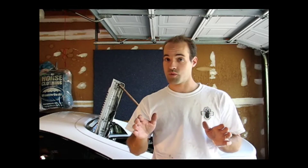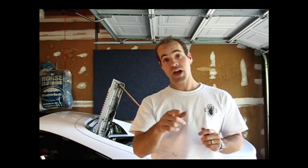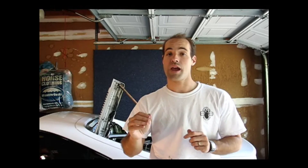Now that we've got the LC1 kit installed, we're finally ready to start tuning and data logging that air fuel ratio. Our tuning strategy involves zeroing out the AFC and then doing a run at about 15 PSI of boost to see what kind of air fuel ratios we get. We're expecting them to be rich, and if that's the case we'll lower the base fuel pressure on the fuel pressure regulator to bring up that air fuel ratio, with a target of about 11.5. Then we'll use the AFC to fine-tune the individual RPM points to maximize power.